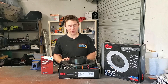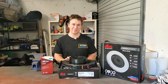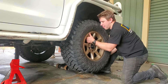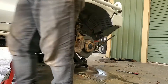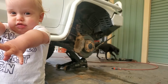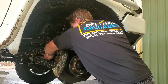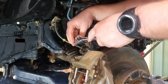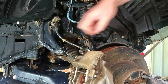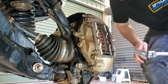I've only got a limited amount of time, so I'm going to jump straight in and film me replacing the rotors and pads on my 200 Series. With the car jacked up and supported on chassis stands, you can now remove your wheel nuts and get your wheel and tyre out of the way and put it under the car for extra safety. If your car is as muddy as mine, definitely give the wheel arch a good clean before you start sticking your head under there.